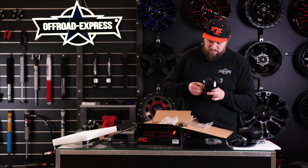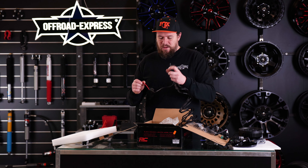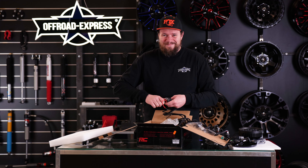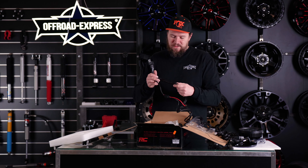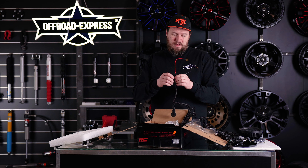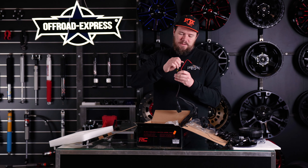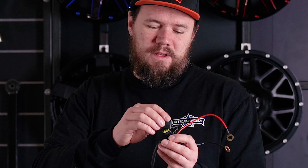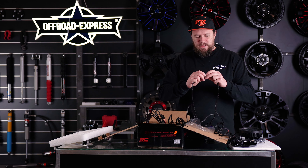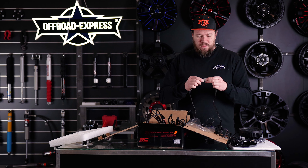Let's unwrap this. There's a real relay on it. The wiring harness is nice and protected. The battery connectors are nice and big so you can easily attach them to your battery points. And there's obviously a fuse — this is a 20 amp fuse, easily accessible and replaceable. The nice thing about this wiring harness is that you can actually disconnect the battery side from the one that goes inside your cabin, because there's this little plug.